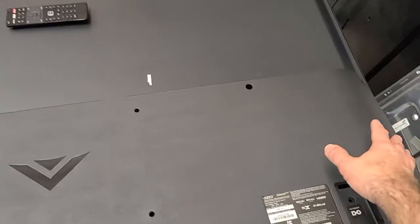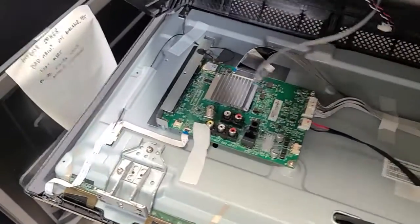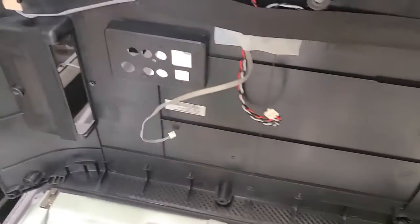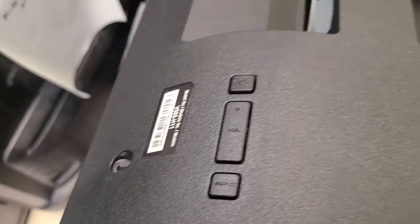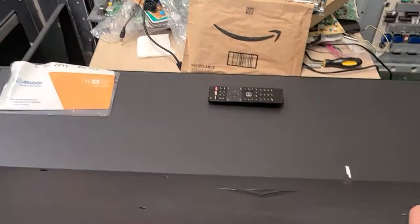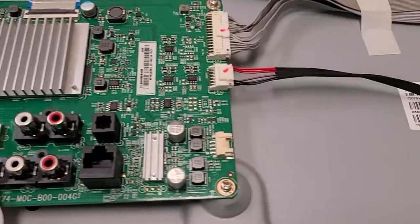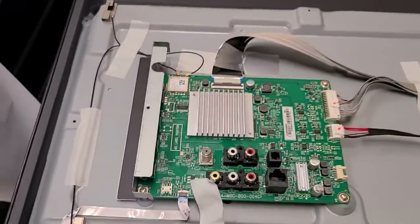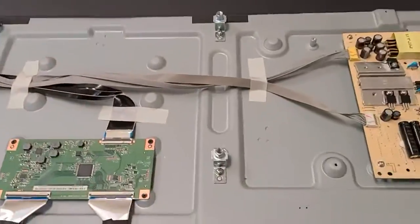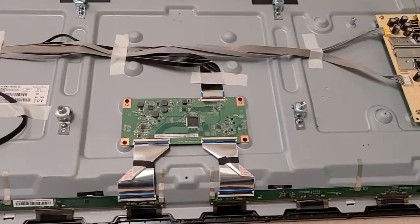It's pretty easy to open up the back. You remove the screws and start pulling that up. There are two cables. This is one of the cheap models where the buttons are on the back cover along with the speakers, so you have to disconnect this from the main board — just don't rush pulling it out. This is the speakers here and this is the buttons. Other Vizio models have both the infrared and the buttons there, which really makes troubleshooting harder.